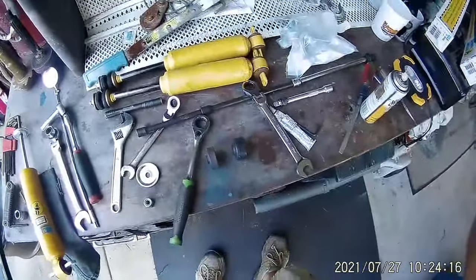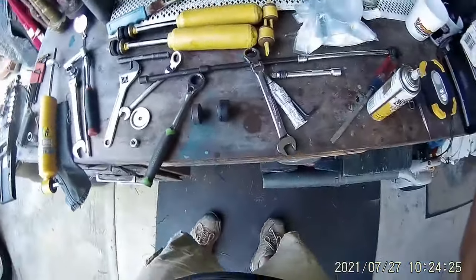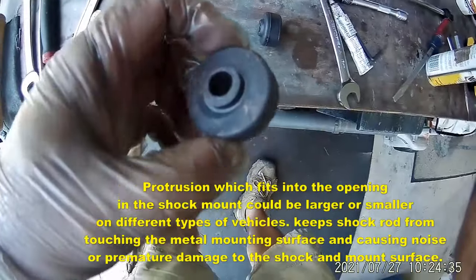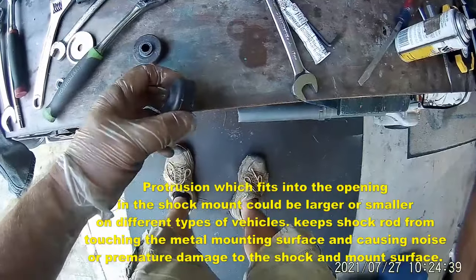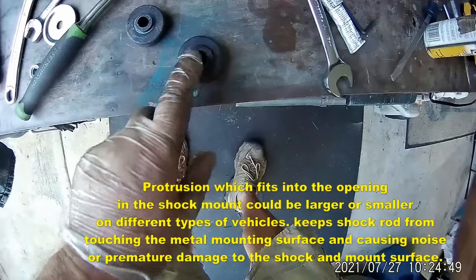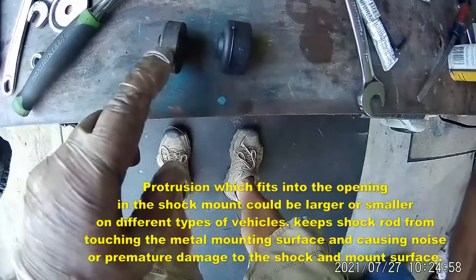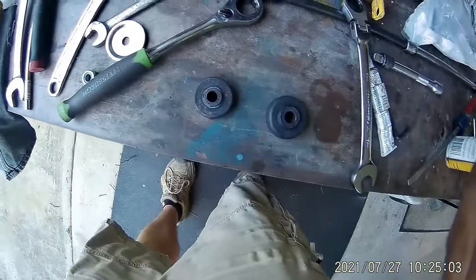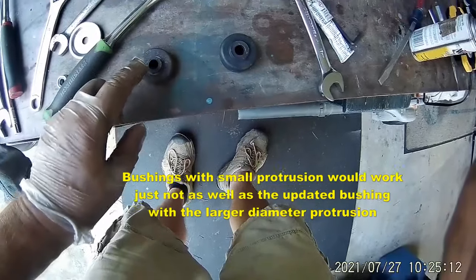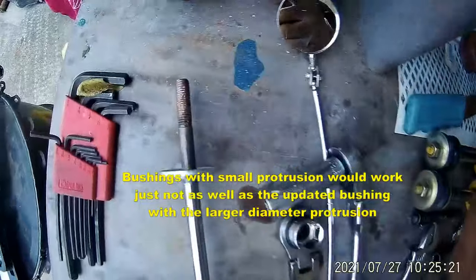One very important thing I noticed: when I ordered these Bilsteins, I ordered them at the same time through the Jungle Store. They came in — as they said, because it was from a third-party vendor — but they arrived in good time, both in the same box. What you can see here is this is what came out of the first box, which is basically wrong. The second box had a bigger hole — this is the size of the hole in my chassis. The first bushing is much smaller, and this bushing is also thicker. So I got two thin bushings with the wrong nipple. I already put the shock on and noticed something was funny, because the nut bottomed out as I tightened it, and the bushing wasn't even squished at all. Bilstein puts a lot of threads on there, so I think the rod is longer.